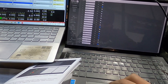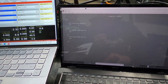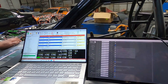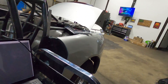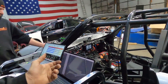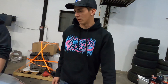Let me give you guys a little of what I got going with the starter here. Here's all the stuff with the starter — input one starter status equals true, and input one starter voltage equals true. I kind of went crazy; I probably only needed this first one, to be honest. Check that out — that's from the laptop, that's from the PDM. That is badass. I'm stoked. No more power probe, no fuses, no relays — the Hardwire PDM made it easy. No more drill. The belt is on and centered. It's going to run good now.